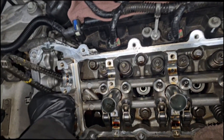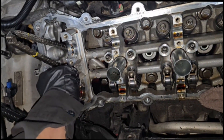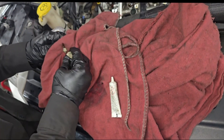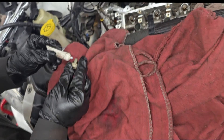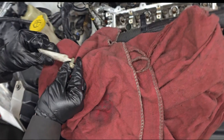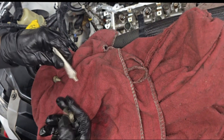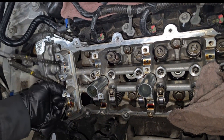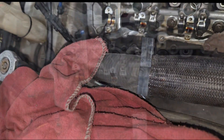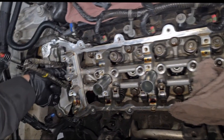Don't drop that down in there - make sure you get that out. We're just gonna clean it up and put Loctite on. There's a torque spec to tighten it, so we're gonna look at the torque spec and tighten it to spec. Hopefully they won't work their way out - that could have been catastrophic. I've seen them come all the way out. On the new heads, they got a plug in that area so we won't deal with bolts - they put a cap in place of these bolts on the updated cylinder heads.